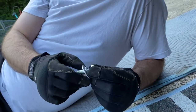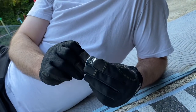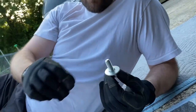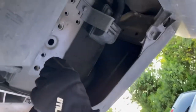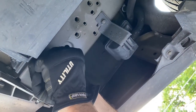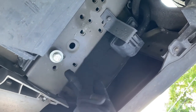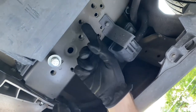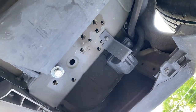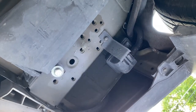The bolts come with two washers — there's a lock washer and then a big flat washer — and that's the order you're going to put them on. Then go ahead and check to make sure that the holes are threaded properly and that the bolt seats correctly. You want to make sure you're doing this with all the other holes before you put your hitch in place, because it's a little heavy and you want to make sure everything's going to work as intended.